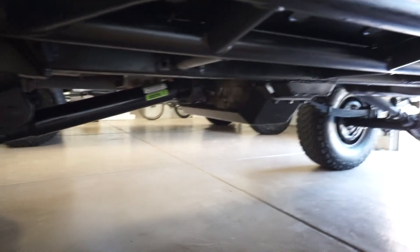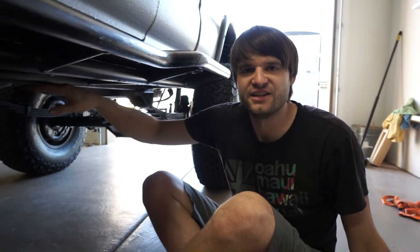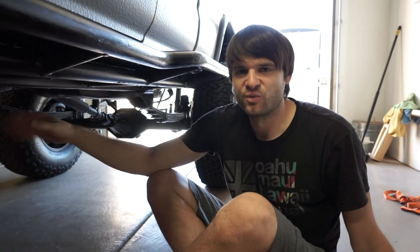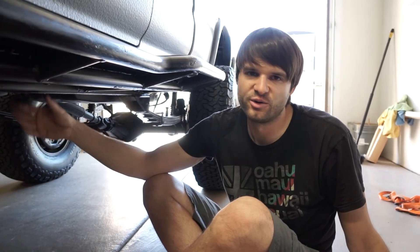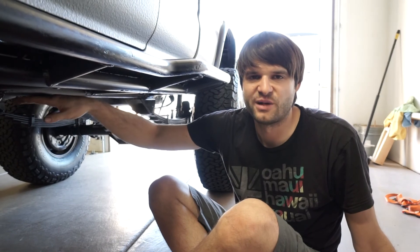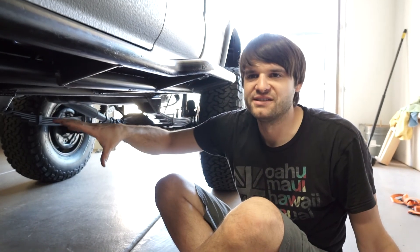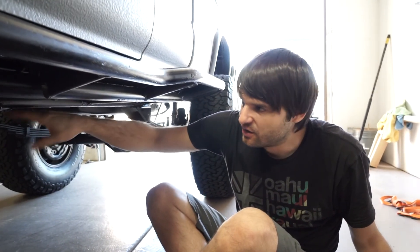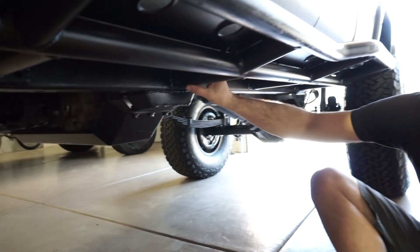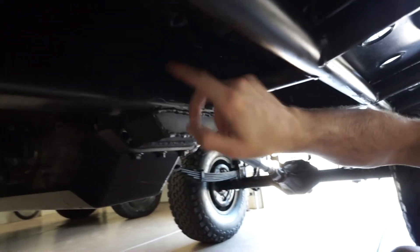It's a good way to keep the overall height low while still being functional. This truck is the perfect height for a rock crawler — you need enough frame height for the really hard obstacles like the Rubicon Trail, Soup Bowl, the old Sluice runs, without dragging the frame constantly. At about 26.5 inches of frame height it's ideal — you can drive over anything, it's not excessively high, and it's really clean underneath.